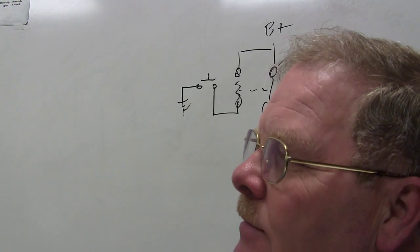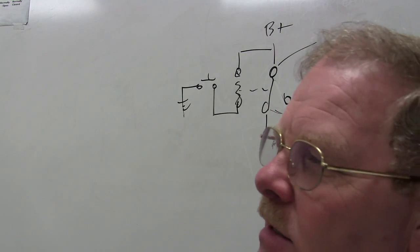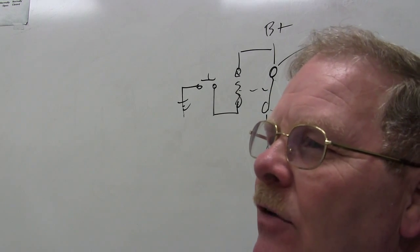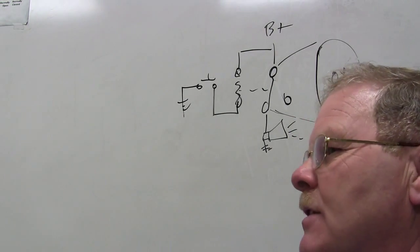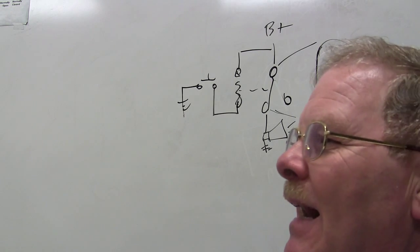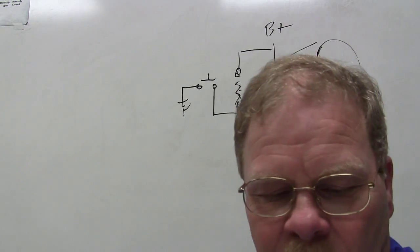The horn ain't no good. Okay, the horn is the component in the most hostile environment and working the hardest. It's usually going to be what fails. Now, sometimes the clock spring will get ripped. The clock spring is the part under the steering column that carries the signal from the horn button down through the column and out to do this stuff. So if your airbag light's on and your horn's not working, you probably got a bad clock spring. Anyway, this question right here.